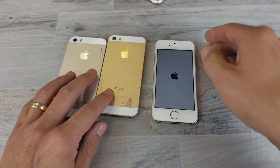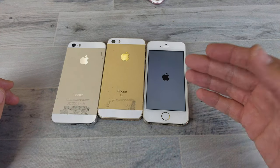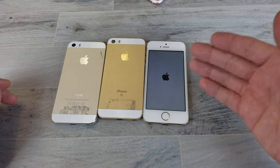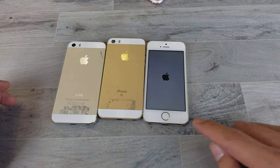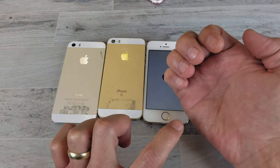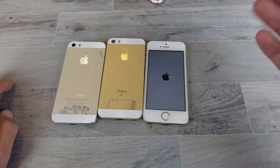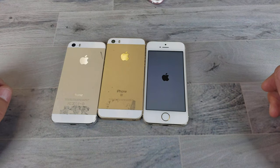Now you can go ahead and let go. If you're still having issues with your phone, you can try the same exact forced restart — try it like five or six more times. If you're still having issues, go ahead and plug your phone in, wait 10 minutes, and then while it's plugged in, go ahead and do the forced restart again. Try it five or six more times while it's plugged in. That's going to solve like 90% of your issues.